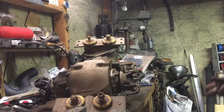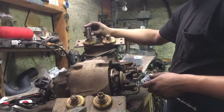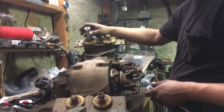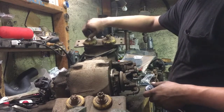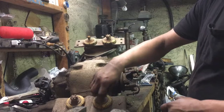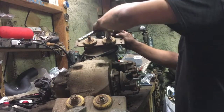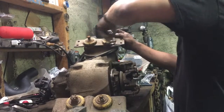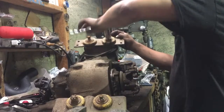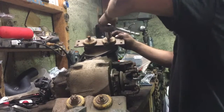There are cotter pins, as I showed you there. That one's a little stuck in the socket. The cotter pins actually were fairly well rusted and very easy to remove. So that was not much of an ordeal. These nuts were fairly tight, not too tight, but you know, enough you might want to have a helper or firm grip on the transfer case when you do it.